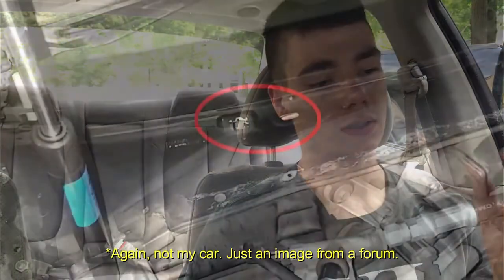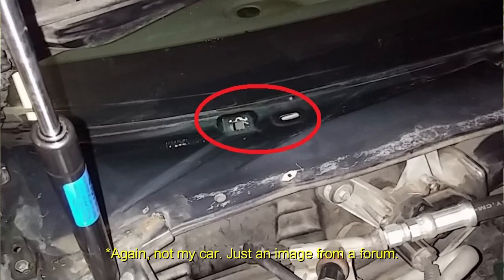We thought it was the windshield at first because when we covered the windshield with plastic and it rained, there was no water inside. However, that wasn't the case — when we took it to Glass Doctors, the windshield company that had replaced the windshield the first time, it was still under warranty. They took off the cowl and found the clip on the right side of the car: a green piece of plastic that's supposed to be seated and glued onto a raised part of metal. Behind it is a square hole, and directly below it is the fresh air intake for the cabin, so that's where all the water was pouring in and getting into the AC system.